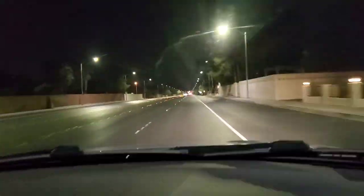Wow, like butter. Awesome. All right. Time to go back and check our dipstick, make sure it's right in the middle. We got her good and hot. She should be 160 degrees now. It's so cold out right now, it's tough to get it up to 190, 200, but you want to just make sure you're in the middle of the dipstick, and you want to check it with it idling in park and with the car hot.